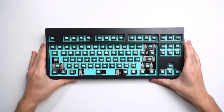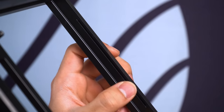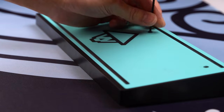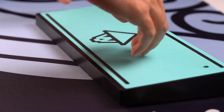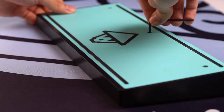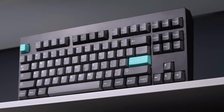The next thing I have to do is screw on the USB port to the case and plug in the ribbon cable to the USB port and PCB. Finally we can put the top housing on, slide the bottom housing into the top housing and screw the case back together. This keyboard uses a pretty unique mounting style that MODE calls a stack mount. Basically, the top and bottom housing fit together with an interlocking front lip that slides into the top housing and secures together via three main screws on the back, which eliminates the need for any screws on the top. Both the plate and PCB then sit on a gasket stack which is squeezed together when the three screws are installed, providing an even typing experience. And of course, I can now put on my GMK Modern Dolch keycaps — this is honestly a dream come true.